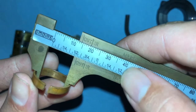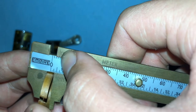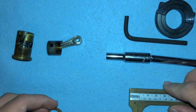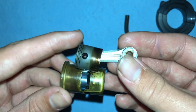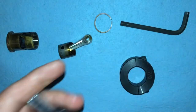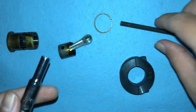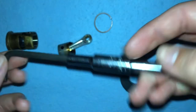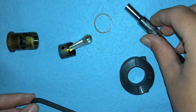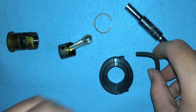I got a three-quarter inch inner diameter copper tube, and it opens up a little when I cut this notch. It is just under four millimeters thick, which is a good thickness for pinching because the pinch will start right around where you want it — just before top dead center. I also have a socket extension with a three-sixteenths inch socket so I can put it on the Allen key for extra leverage, but that's only needed if I've clamped it as tight as I can and the pinch still isn't tight enough.